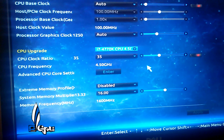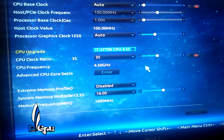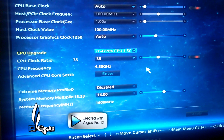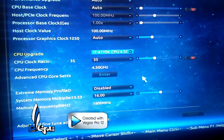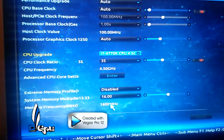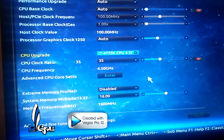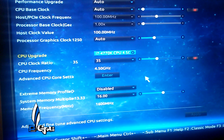If you can get a processor to 4.5 at under 1.3 volts on the 4770K, you have a good processor — which in my case I did, luckily. So once you set that up, you've got to change your frequency and memory as well. It's linked up together. I put mine at 1600, and I've always overclocked my processor with RAM at 1600 at 4.5.